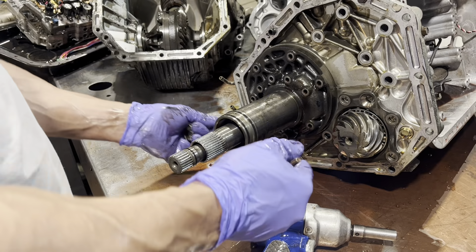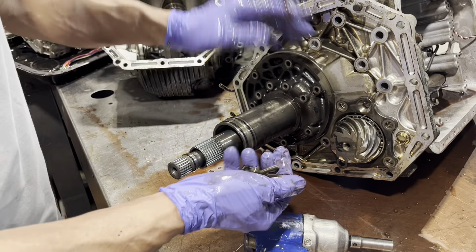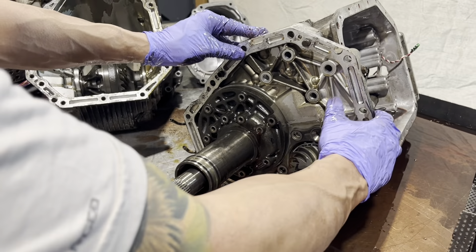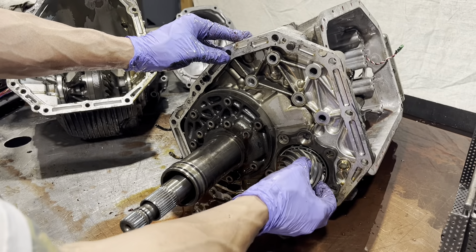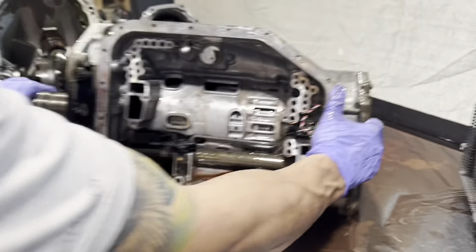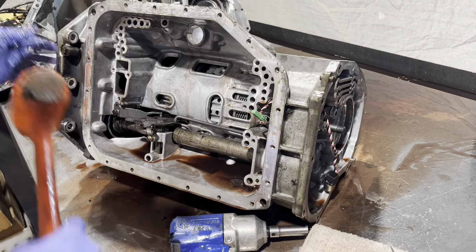A lot of this transmission has seals that are separating the gear oil from the front differential from the transmission fluid in the back. I like to hit the pinion shaft through from the back. This is why I left the one bolt in — otherwise you might have the whole thing come apart.